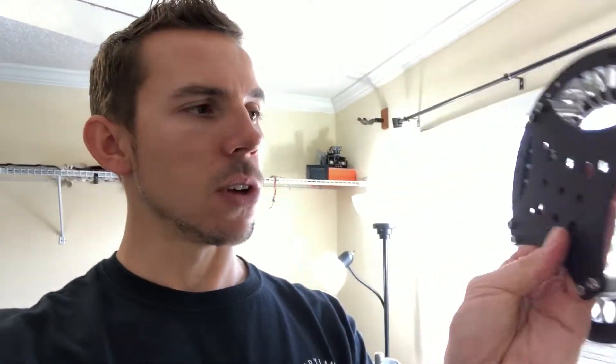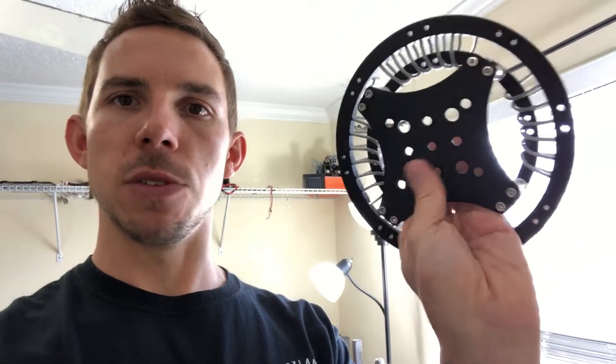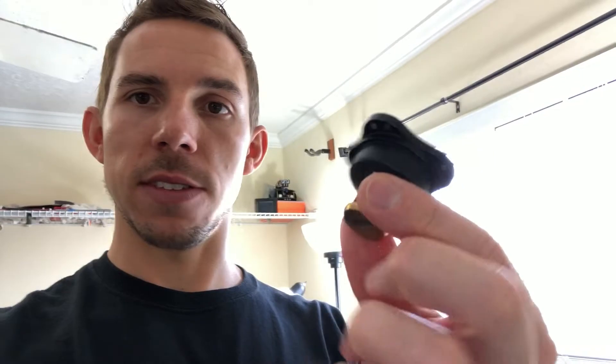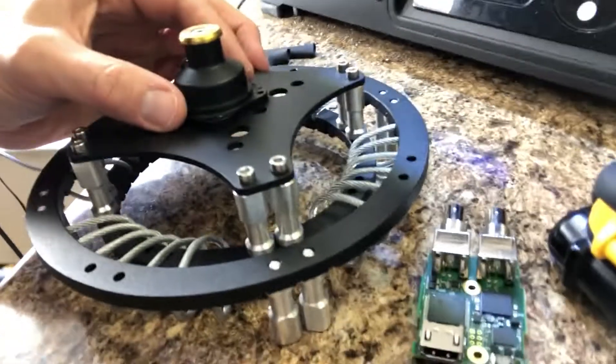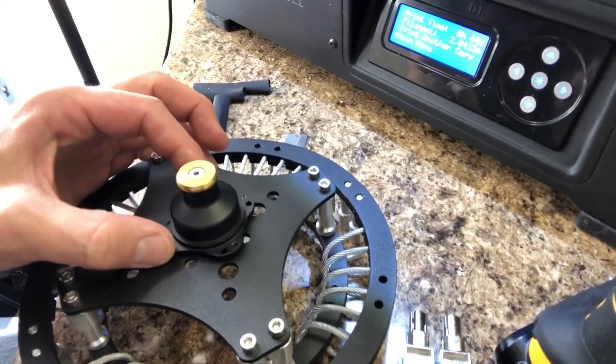Here's the part I use on my big drone. This part will stick to the bottom of the drone, and then we have an isolation dampener here with these wires. The gimbal will bolt on here and the camera will bolt on here — this gets rid of jitters and Jell-O and such. I've got these holes in this plate, and usually people will bolt a heavy-duty dovetail system to these holes. Now the customer wants to use this adapter for a different kind of gimbal, so I want to attach this one to this. But as you can see, I do not have the right bolt hole patterns lined up.